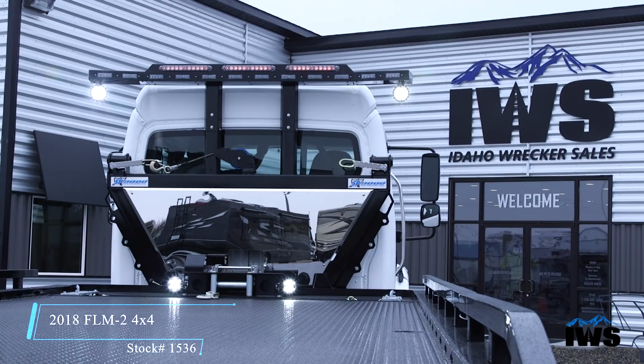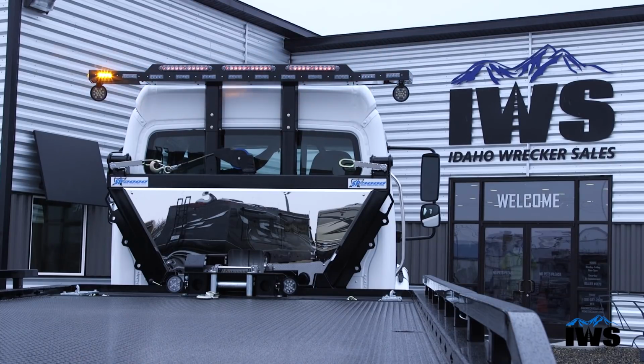The alley lights and deck lights are on post mount, so they can be angled to any position you need for use. The light bar itself has a built-in safety director function, which you'll see here in these demonstrations: center out, left to right, and right to left, and vice versa. The three lights along the top of the light bar serve as your brake, turn, and tail lights. So overall, this light bar gives you a tremendous amount of functionality with beacon mode, safety director mode, alley lights, and it gets the lights out to the side of the load for additional safety.